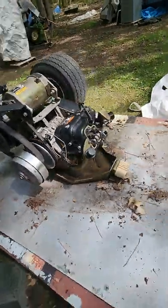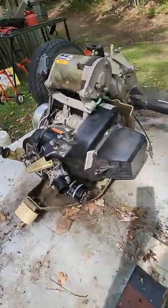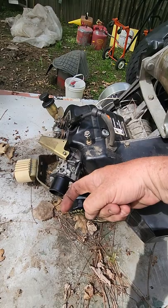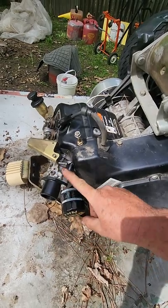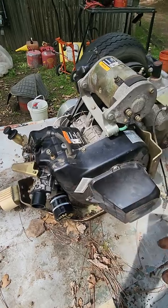This unit had the head replaced in it. What had happened was the intake valve was bad — it would blow and backfire, and literally caught this on fire and melted it all. Inside was a mess, so we cleaned it out, redid it, put a kit into it, and changed the oil.